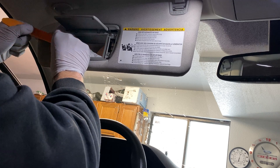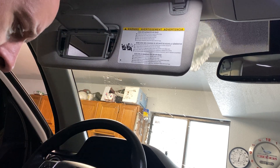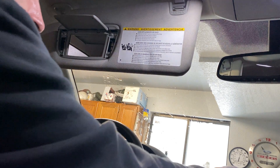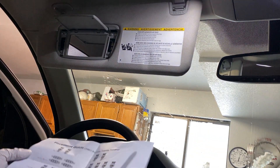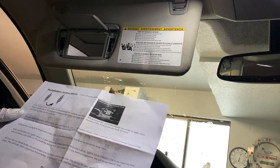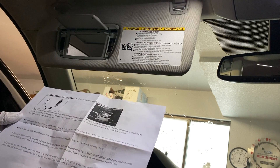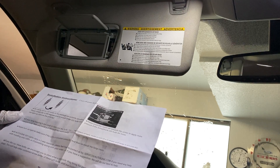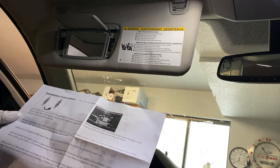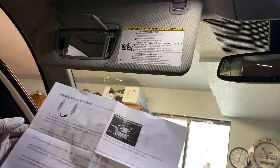Let's push that out. Just read something in here about the vanity lights. The vanity mirror LED bulbs in the package are polarity sensitive. Simply flip it 180 degrees and reinstall if it does not light up — it's the polarity. So they are polarity sensitive.